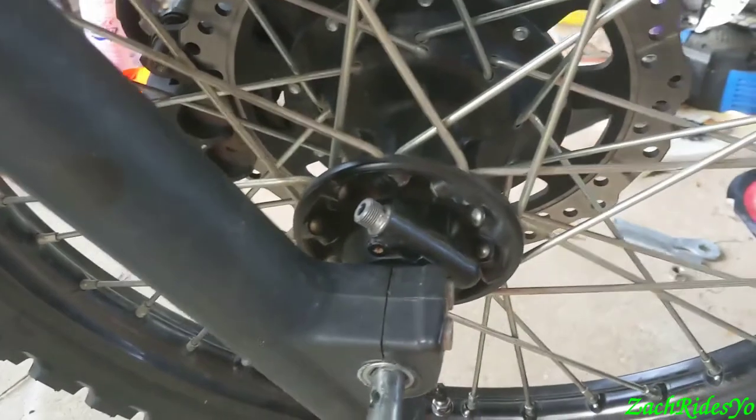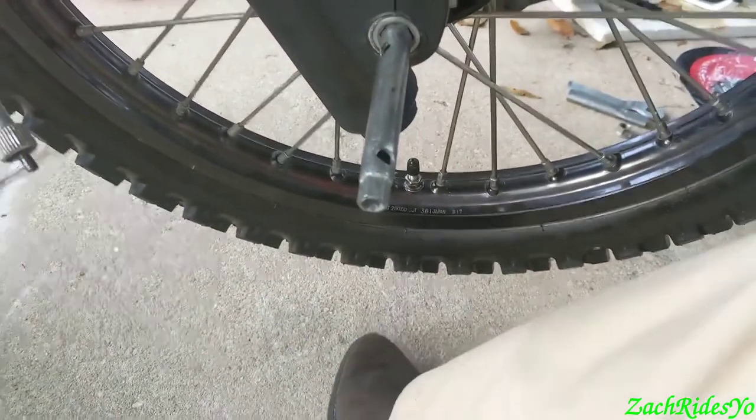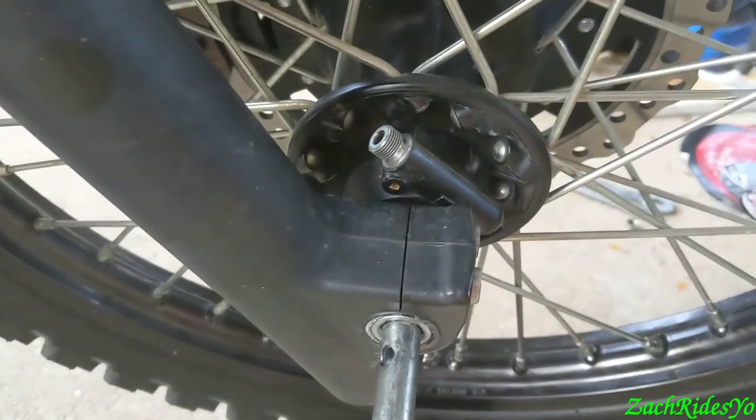There's the correct orientation for this. I don't have the nut on the other side of the axle, but I do have everything engaged — the axle's all the way through — and see how I can't turn that either direction. The play that's allowed and the angle that this is pointing, that is correct. The tire's off the ground, just FYI, but there you go — that's proper orientation.